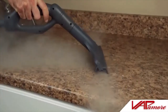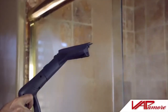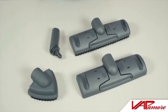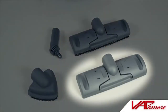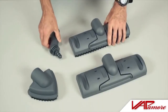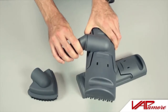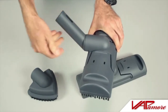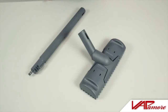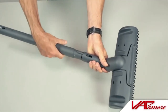The smooth surface squeegee can be used on countertops, smooth surface cooking tops, shower doors, windows, or any smooth surface area. When using the smooth surface floor head, bristle floor head, or triangle corner brush, attach the elbow adapter by inserting the male end of the elbow adapter into the attachment. Then rotate the elbow attachment to the up position. Attach the desired number of extension poles by inserting into the elbow adapter.